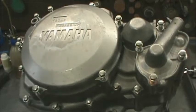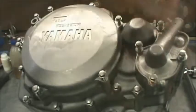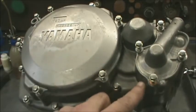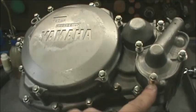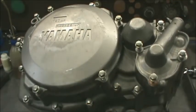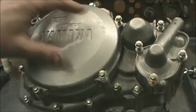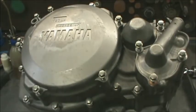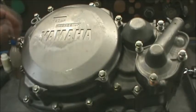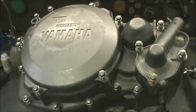In a nutshell, I've got all my bolts in — nothing tight. The long bolts are the ones that go through the water pump housing into the case. There's another one here, and I need to look at this bolt that holds the water pump cover on — there's a little brass washer under it that has to go there. There are only two other bolt lengths: a little bit shorter for this cover, and everything else in the clutch cover is the same length. I'm going to make everything in here finger tight — just bottom it out, no tension on it.